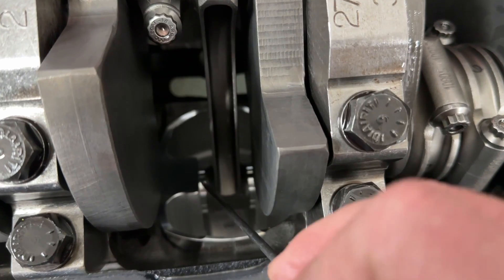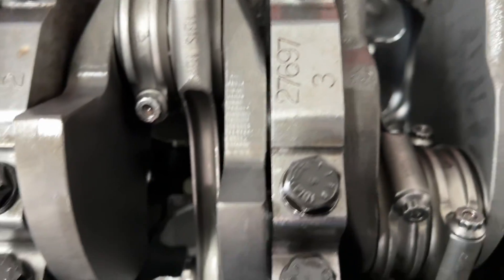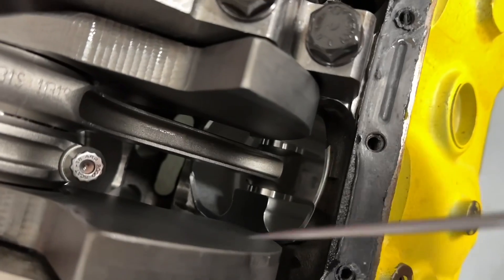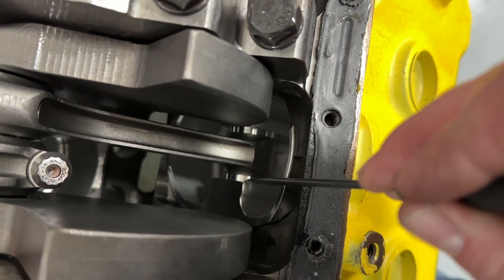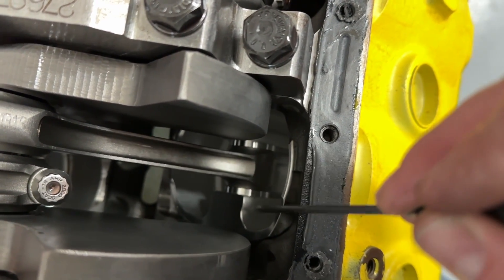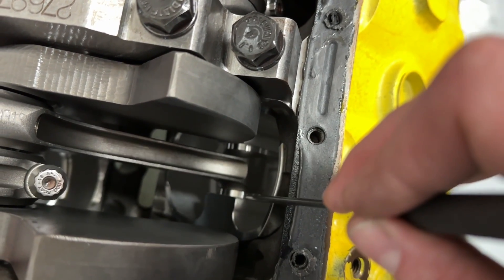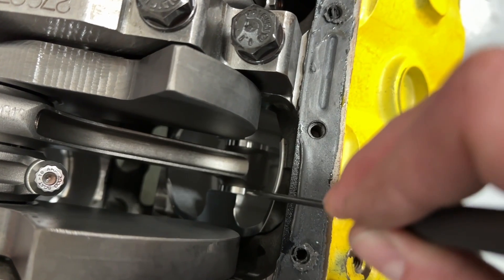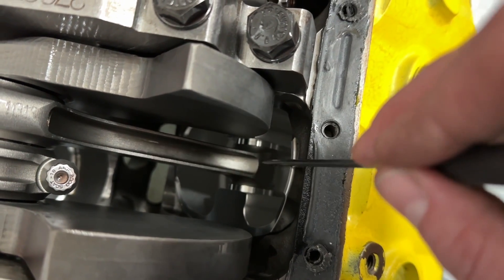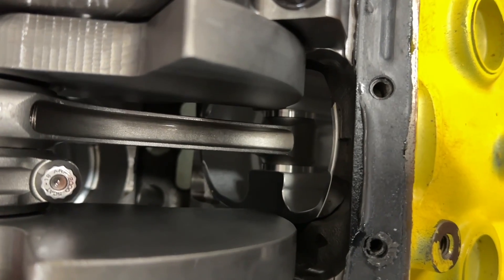See that aluminum piece right here? And that aluminum piece right here? It looks like it's the pin, but it's not the pin. This little piece here — which you'd really think is a pin — these are aluminum washers. What happens is you machine the piston and take these aluminum washers to go around the wrist pin, and they touch the piston and then they touch the rod. You sand these to get the right clearance, and that keeps the rod aligned with the center of the piston.